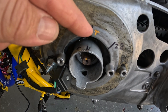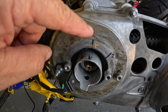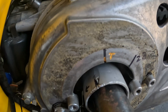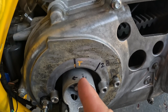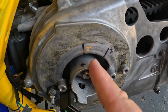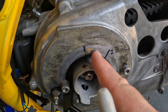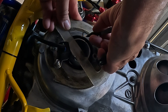On your car you'll see a flywheel with a marker on it — and there's a marker on the engine itself, the indexing marker. Before top dead center would be somewhere before TDC; as the engine's coming up on top dead center, we need it to fire somewhere before that point, not right at TDC and not after. Most every engine in the world runs 10 to 12 degrees before top dead center at idle — and that's usually where you set it. So I've got to figure out what 10 degrees is on this. I'm going old school primitive — got my third-grade protractor. We're just going to call that 10 degrees; it's going to be close enough for what we're doing.